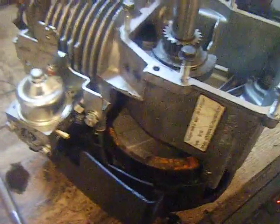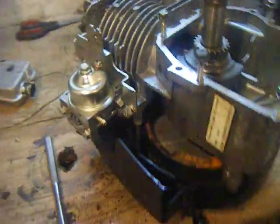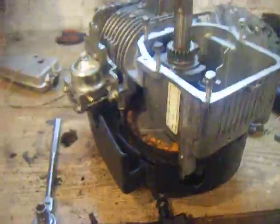Yeah. So you need to sort that out. Another problem is the flywheel. That's not cast iron, and you need it to be cast iron. If it's not, it won't run. Even though this flywheel actually stands to be pretty hefty, it doesn't look like aluminium. I don't know what that's made out of, but it's pretty hefty. It's not hefty enough for this engine though.